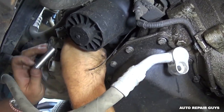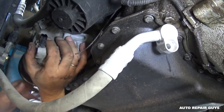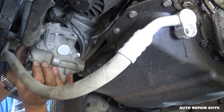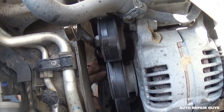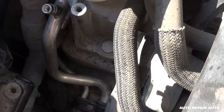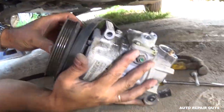Removing that one now — last one. Now you can grab it and pull it out. You need to pull it toward the front; if it's stuck, wiggle it a little bit and it will come out because there are aluminum guides there. You'll also need to remove the second inner belt — with that same 15 millimeter, pull it down and go clockwise again to let the belt go and pull it out. Make sure you have both belts off.